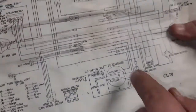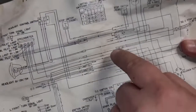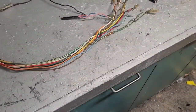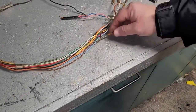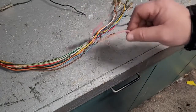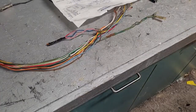So, the way this print's showing it, I was looking at the print, I was wondering why this is dead-ended, not going anywhere, and the red and white not going anywhere. So that kind of makes sense now. The print's really not showing it as a connection, but I think that's what they're trying to show on this print. So, if anybody knows any different, somebody's got a little more knowledge on these old Hondas, definitely comment below. I'd be interested in your opinion, but I'm going to verify all that. I mean, somebody did that at one point, whether it was the factory or somebody trying to repair something, but I do believe that that's the way it's supposed to be, and again, it has to do with the rectifier, so it probably makes some sense.